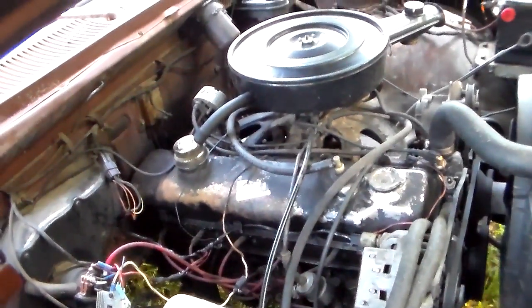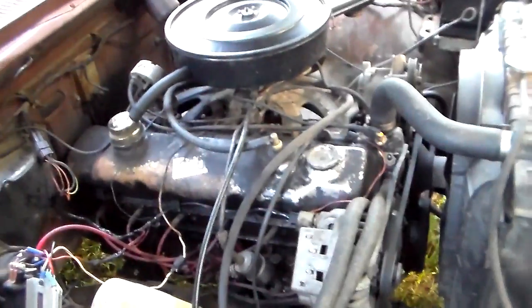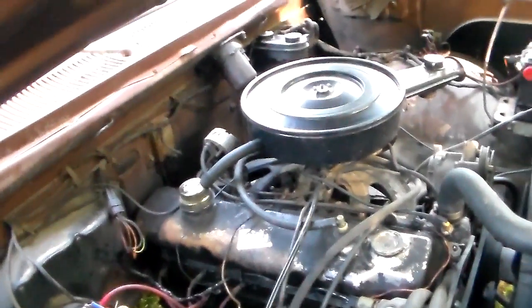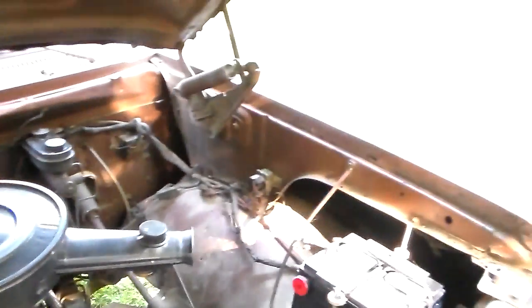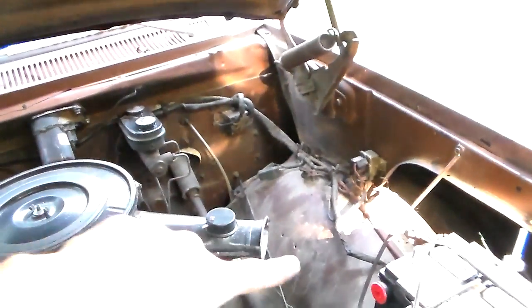If you've got any questions please ask and I'll do my best to answer them. The nice thing about this is if I swap engines — I've got a 318 in there but if I do, this ignition system works exactly the same. The only thing I'll have to do is get a longer coil wire and maybe extend a couple of wires, that's it. This setup can work on any vehicle — older Fords, AMCs, anything that had that external box and didn't have a GM HEI or a Ford Duraspark ignition system already.